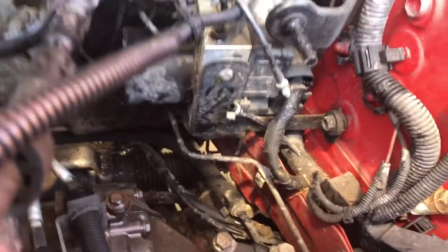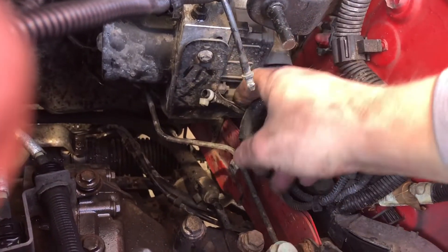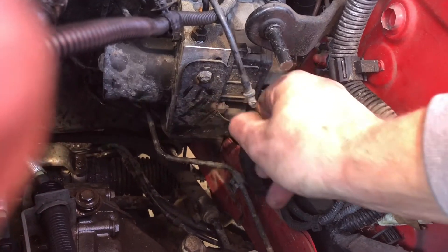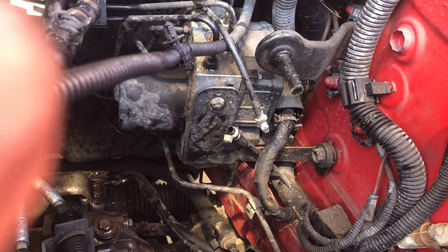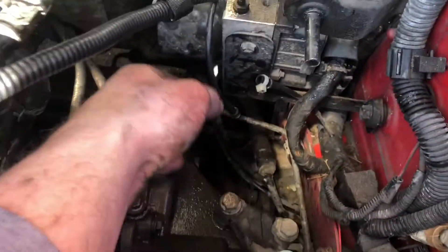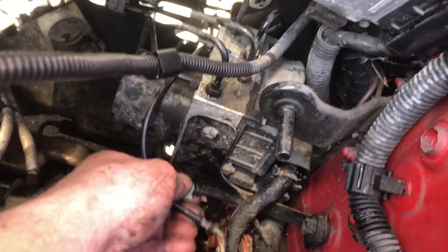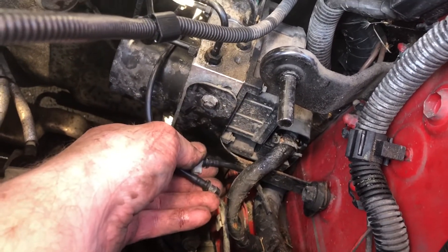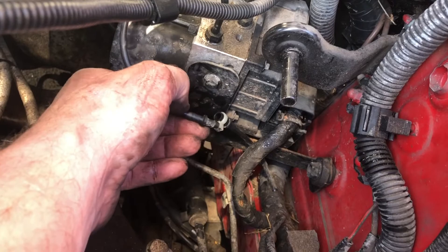With the air cleaner out, we can see the culprit - a thinner bore pipe. I feel a right doofus but the water deflecting made it look like it was coming from elsewhere. I've rerouted the pipe under the ABS controller so I've now got a lot more slack, which should take the pressure off it. I'm going to try and clamp it together better than the cable tie, which is doing nothing on hard plastic.